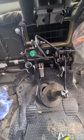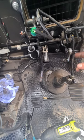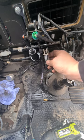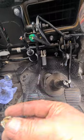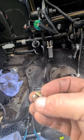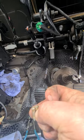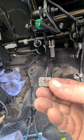Don't forget to plug your switch back in. Hook it round, take that off, pop that off. You need to take that off - that's a bit of a pig to get on and off with a pair of grips. I'll pop that clip off - I think I've shown you how to do it - and bend the little tab back. It slides on the back like that, slides back down, clip it on. That's like a security tab; bend this one over like that. Once you've finished, it completely locks it in to stop it coming off because it's trapped behind there.